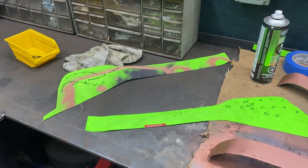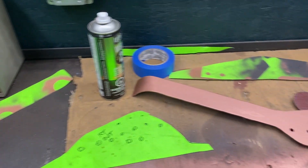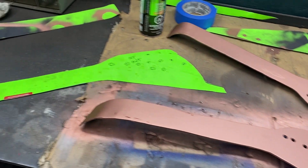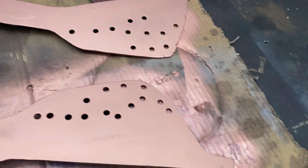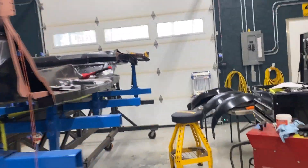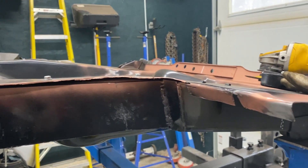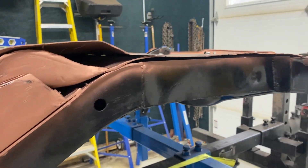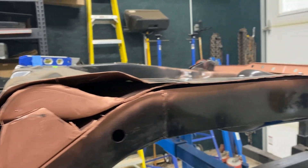I made a couple of cardboard construction-paper-ish templates, marked where I wanted my holes, transferred those to a piece of sheet metal, and cut them with a plasma cutter. They came out alright — the top edges are a little wavy but that's where the panel is, so I'm matching it up as best I can. Everything is prepped up and set back in so these can be welded nicely. Next step is tacking these in and leveling them up — I need to recheck the level on the chassis first so I can plumb everything.